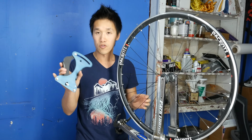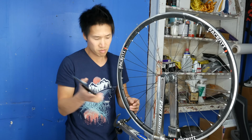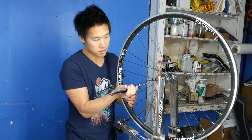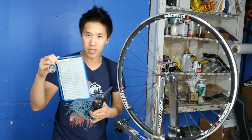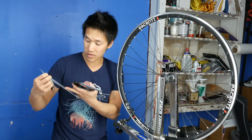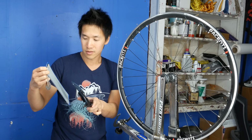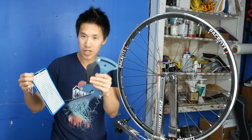Now this is a very affordable tension meter that I bought from Park Tools. It's lasted me a very long time. I think these are like 40-50 bucks. And something I check is that all the values are reading between 15 and 19. They actually give you a kind of conversion table here, and these are the 1.7 millimeters, so you go to the round steel 1.7, and you go by the numbers that it's reading. This all converts to Newton force. So as long as all my numbers are reading between 15 and 19 on this meter, I'm good.